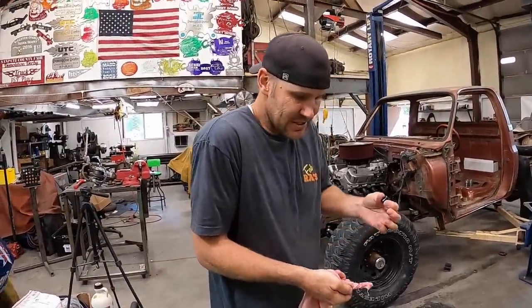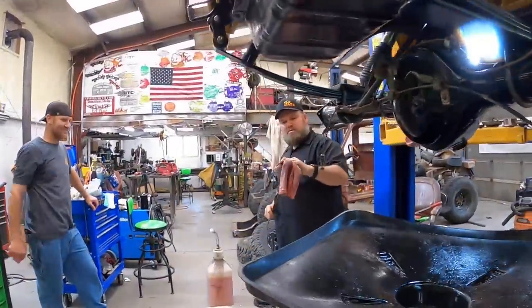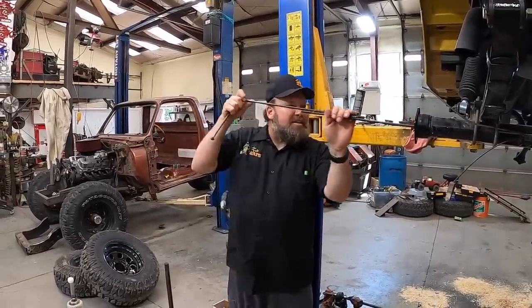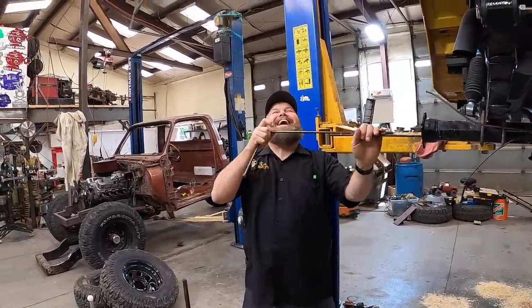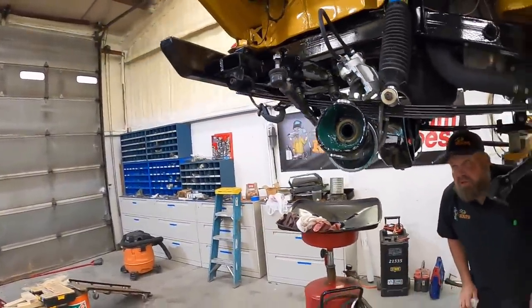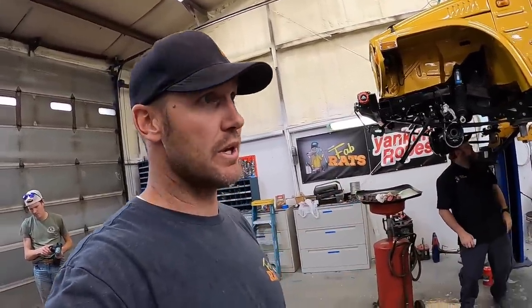It's its job — that's what it's made to do, is to get in and clean all those surfaces. We're breathing. Alright, we got this thing cleaned up, Ben has been scrubbing on it. She's clean and ready. We're gonna silicone it and start reassembling. We're waiting for bearings for the rear, but the front can go back together. So here we go on it. Gotta make the silicone squish out the sides — then you know you don't have a leak. Just a little snug all the way around and we're done. Now we just gotta throw the axles in it — done.